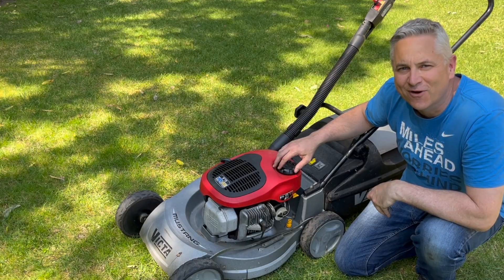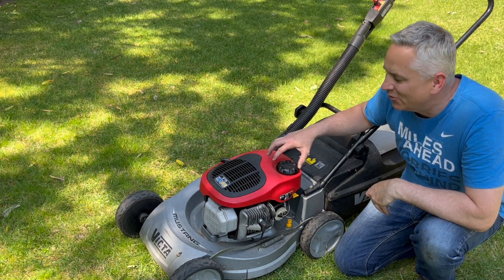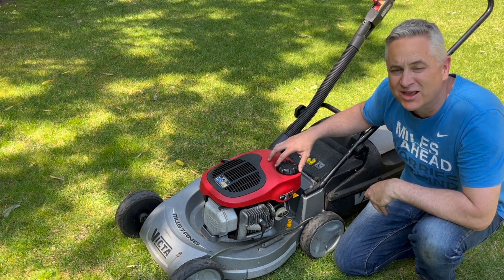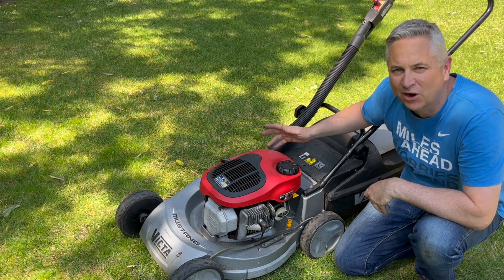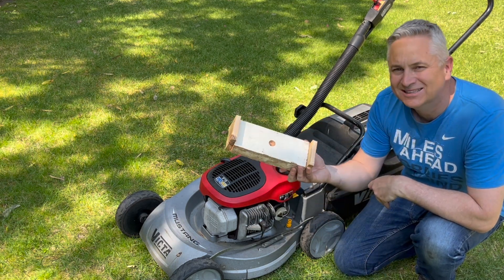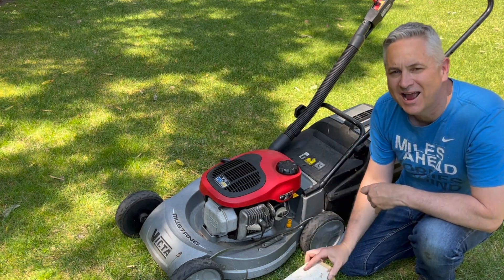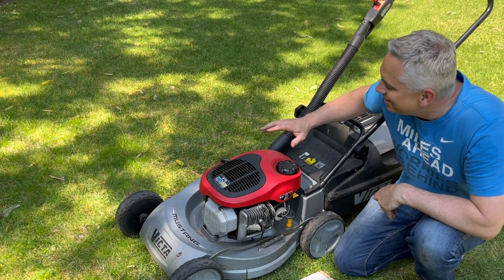By swapping that long spring in the G4 carburetor, we've now got this mower revving at what I think is a perfect RPM — just below 3400 RPM. We achieved that by testing the different governor springs with the homemade jig and kitchen scales.